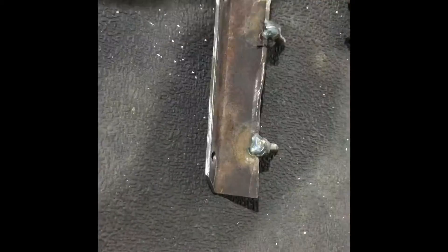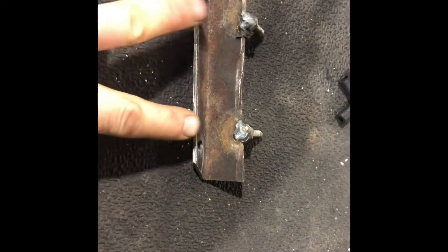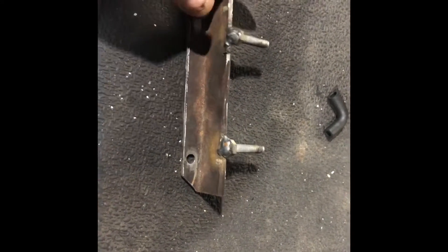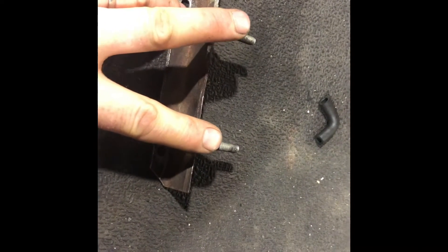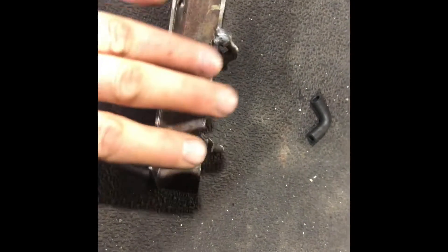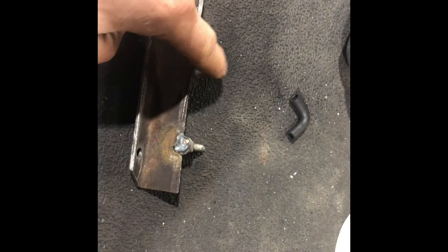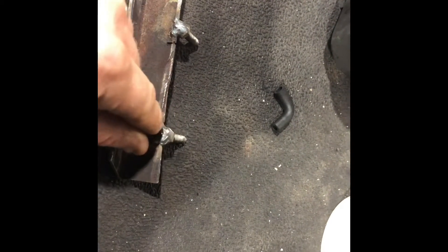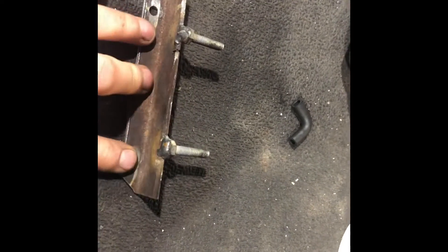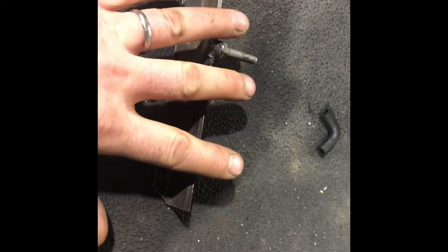This is as basic as I could get. I have this piece — it's just a bit of box iron that I cut — where I was kind of stuck trying to save myself a bit of time. I used the two bolt holes for holding down the rocker cover at the timing chain side, and I bolted that down. Wherever the pulley of the camshaft stopped, I didn't weld these on until I bolted this down first. Then I sat up my bolts holding the oval cut-out of the camshaft pulley, sat them to one side, and put a spot of weld on it. Same on this one — I ran it in, held it to the opposite side of the pulley slot, and put a spot of weld on it. When it was bolted down and held in here tight, it's holding the pulley in place — the pulley can't drop, the pulley can't turn. It's just held by two little spots of weld.